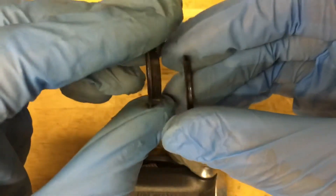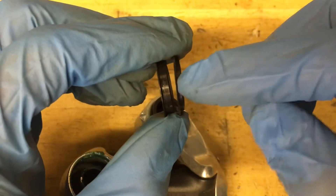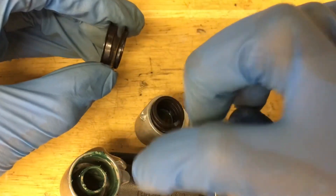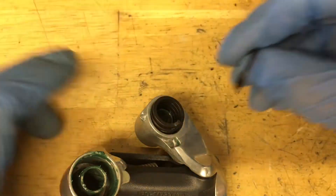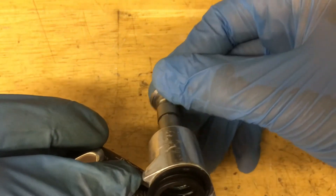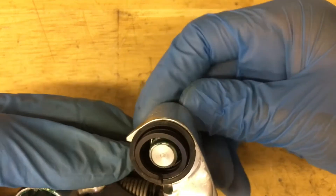You also have two plastic seals — they're pretty similar. You want to use the thinner one for the pinhole right here, and the thicker one we'll use on the other pinhole. Get that thinner seal and put it on. Then go ahead and slide in your bolt with a little bit of a rotating motion so the grease spreads evenly.